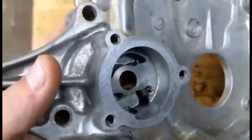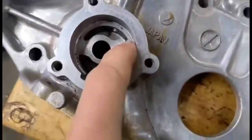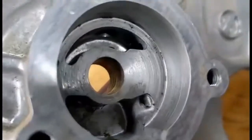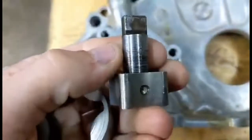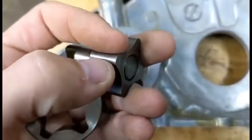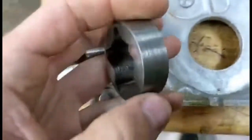For oil pump inspection, what you're really looking for is big scratches along here and then inside here. This one's got some pretty nasty scratches because it's getting set up to get a new bushing installed, that's why it's so clean. And then you're also looking on the rotor — you're looking for big gouges inside there, big nicks on here. Anything that got sucked through will mess this thing up. Big scratches through here.